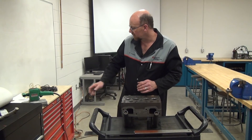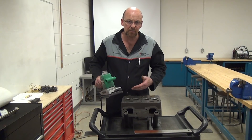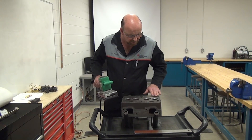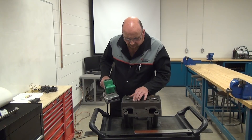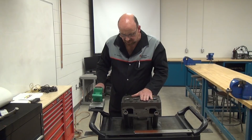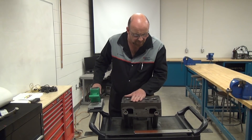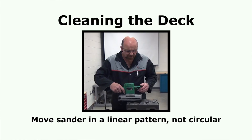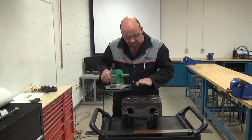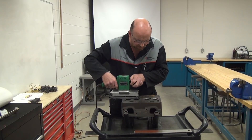First thing I'm going to do — this may be loud for a moment — is clean the deck surface, assuming that we don't have any problems. There is some rust here, some small scratches, a couple little dings. These heads were purchased used, and I'm just looking at them to find out if they are still serviceable. One of the things you want to do is move in a linear pattern back and forth. You don't want to scrub around in circles and create distortions in the top of the deck.